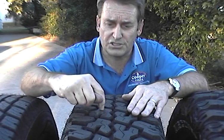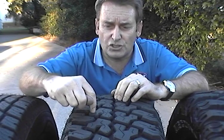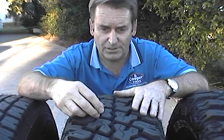Notice also there's little sipes or cuts in the tyre. We talked about those being made to work on greasy roads. Well, they put them internal within the blocks, they don't go to the edges at all, and again that reduces the chipping off-road dramatically, so the tyre will simply wear longer. They still chip, but less than anything else you'll buy.